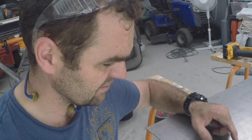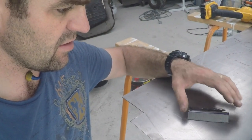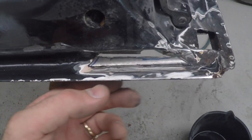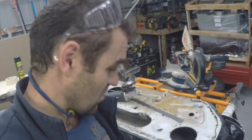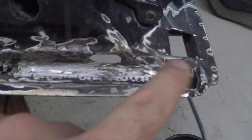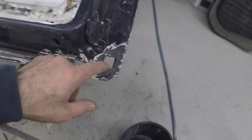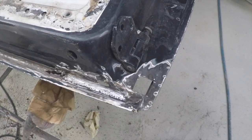I've taken the little rusted piece and marked it out onto the curve that I beat out on this little trial piece, and I've scribed it onto here. Now I've got to cut it out and see if we can weld it in. Here's my first trial piece and as we can see, it's a little bit too big a gap around the edge, so it's back to the drawing board. Well, the first little rust patch turned out pretty good actually - I'm pretty happy with it. The only issue I found was when I started grinding it away, there's a lot more rust all the way along that I'm now going to have to patch as well.